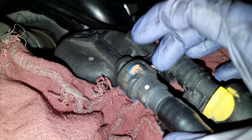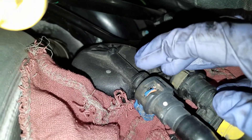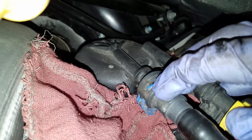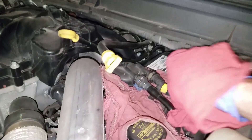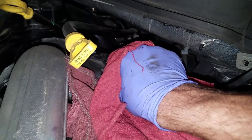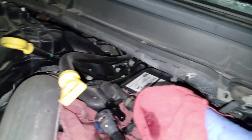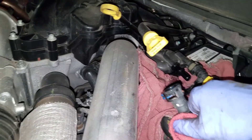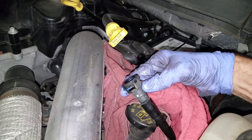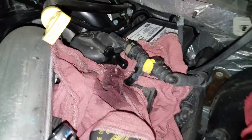These connectors move like that — we want to push both tabs at the same time and push. We're pulling this way and pushing it down. So this fuel line is ready to be taken off. I'm going to try to do this all with one hand — pull this line off. Any burst of air? Nope. But we've got fuel coming out as expected. I take this line and go right around my oil fill just like that. It bends right out of the way, no issues whatsoever.